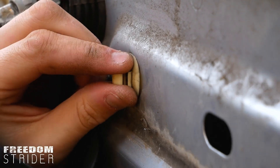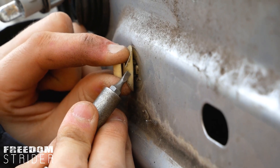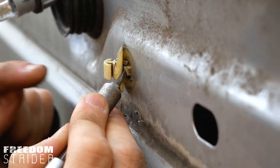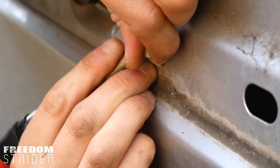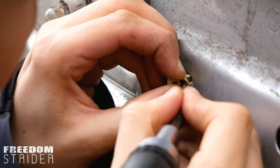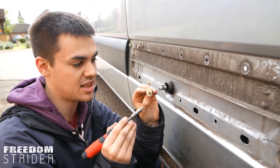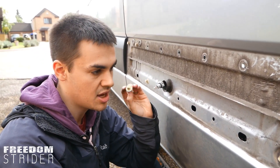To remove these clips from the van, you tuck this under and tuck this lip up — you'll see a little plastic clip underneath that you have to get with your flathead screwdriver. So you clip it there, get this side out, then there's one on the completely opposite side that you have to get out without letting the first one slip back into the hole, which proves to be quite the conundrum. These tiny clips — there's no sealant, no waterproofing, it's just that clip rubbing against the metal. That's all that's protecting your van from water getting inside, which is completely ludicrous.